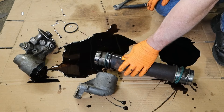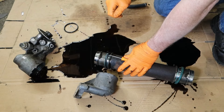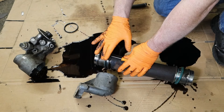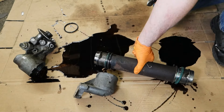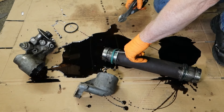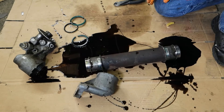Now for the o-rings on the inside — if you've worked on injectors you'll know: when pulling o-rings off an injector you don't want to reach in there with a knife or anything that's going to score, scrape, or gouge it. Treat this oil cooler the same exact way. Get underneath the o-ring and just pop it like that — and there we go, she's all taken apart.